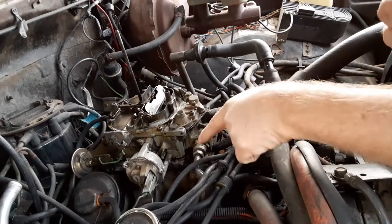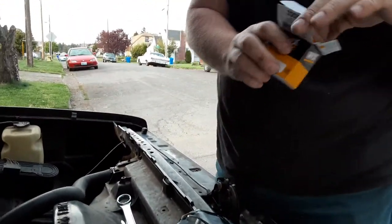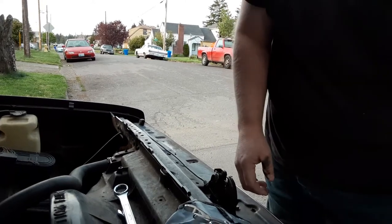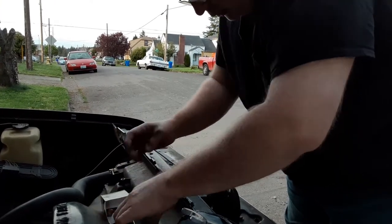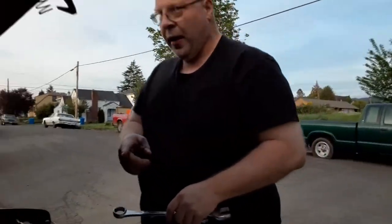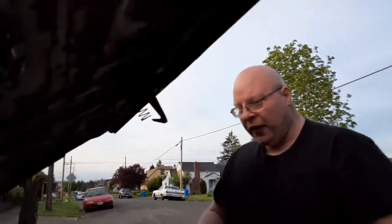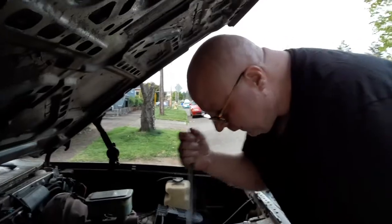It's sitting inside the carburetor right here. As you take it out, you want to make sure you know which way it goes, because it won't run otherwise. Trust me — there's a flow side and if you put it in backwards it just won't run. My buddy had a new fuel filter put in line on his 454 truck, and they never changed the internal one. There's one in-line and one internal — we'll show you in a minute.